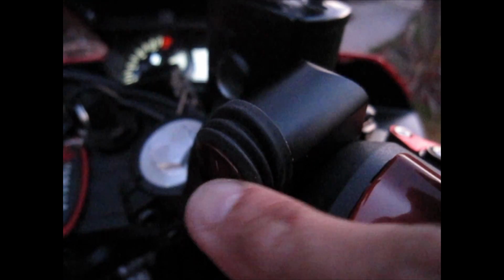I've noticed that if you don't hit the switch right on the plastic itself and you hit it on the rubber, it kind of just goes off. Other than that, the switch is really good. Then you would just have to put the rubber back on there. It becomes a pain in the butt, but prior to installation, if you put a little bit of glue, maybe some Gorilla Glue or Crazy Glue, and then put the rubber seal over it, that'll eliminate this from happening.